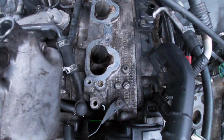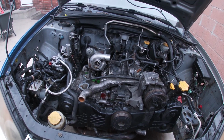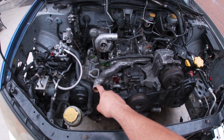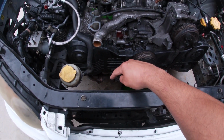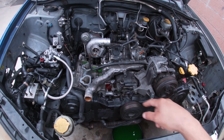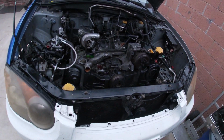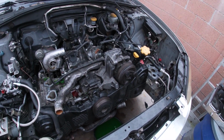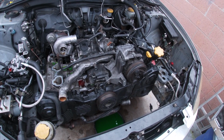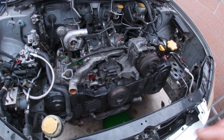It's kind of hard to tell, but yeah, you get that oil leaking into the head, and it goes through the headers, back into the turbo, and back into the intake system, and back. It's just a circle of oil through your motor. So we're gonna do some head gaskets and rebuild the heads. We use stock block, still showing good on compression.